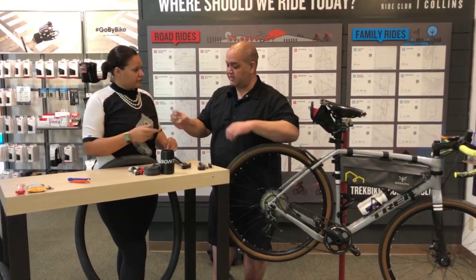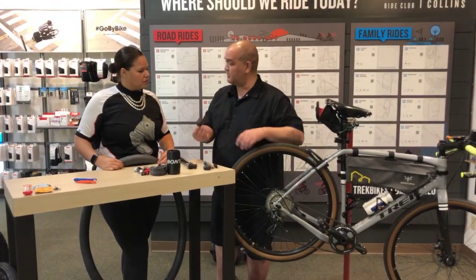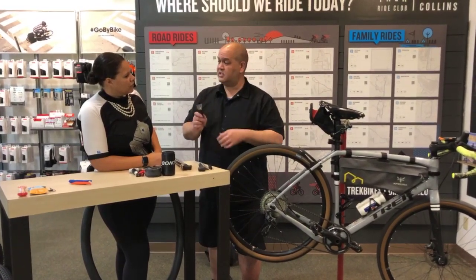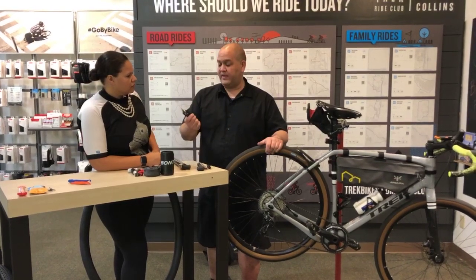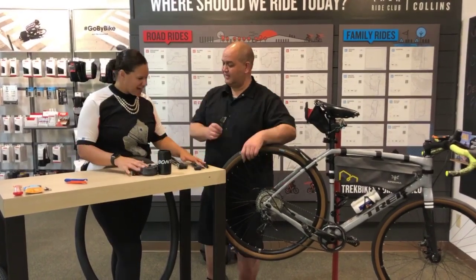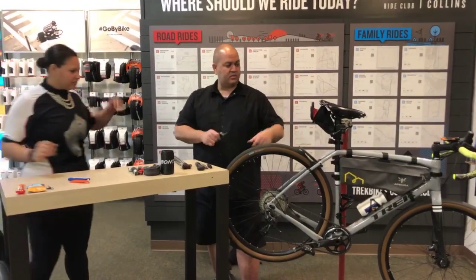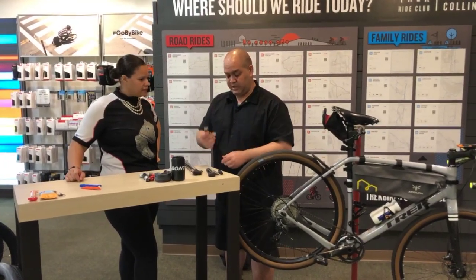Multi-tools, very compact, are designed to give you everything you need to fit 99% of the items on your bike. Everything on your bike is going to be metric, so multi-tools are going to be metric. Four, five, and six millimeter Allen keys are really the essential ones — every multi-tool at any bike shop is going to have that. With this, you could actually disassemble this bike with the exception of the chain and pulling the bearings out. If you're trailside and you crash, your seat got twisted or handlebar got twisted, this allows you to make that adjustment and keep going. All of that fits right inside the seat pack.